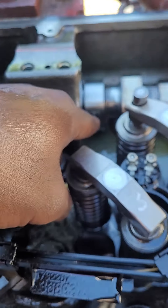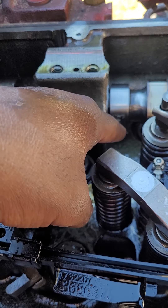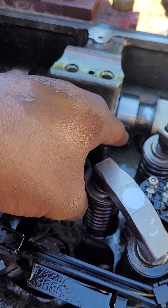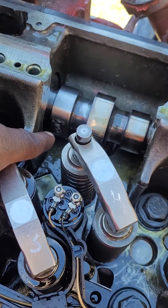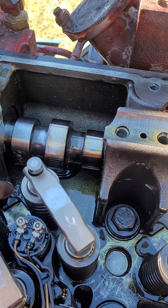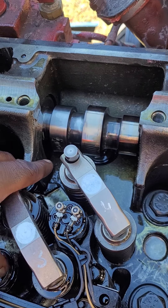I got my overhead run at a certain shop, and I'm not blaming them, because I know this is a notorious problem for Cummins. And 10,000 miles later I heard the engine go chirp, chirp at idle. So I pulled the valve covers off and this is what I found — that lobe right there was pitting, and that rocker roller was pitted pretty bad.